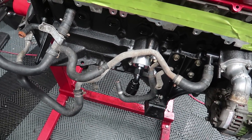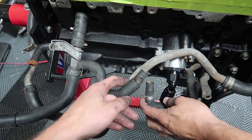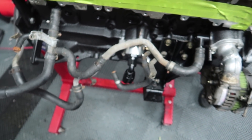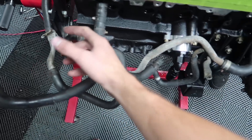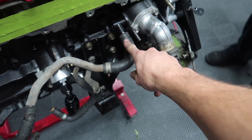That really makes me feel like I did nothing today, but I feel like I've been in here the whole time — maybe I've just been doing a lot of cleaning and painting. I've painted a lot of little random stuff to try to make it look nicer, like pulleys and brackets. Right now we're figuring out how we're going to run all the water lines. All this factory heater core plumbing means two coolant lines going into the car, plus the factory water-to-oil cooler — and we're not going to use either. Every single clamp is a possibility for a coolant leak, which could cook the head gasket. So the solution is just run one line from here to here and delete all that crap.